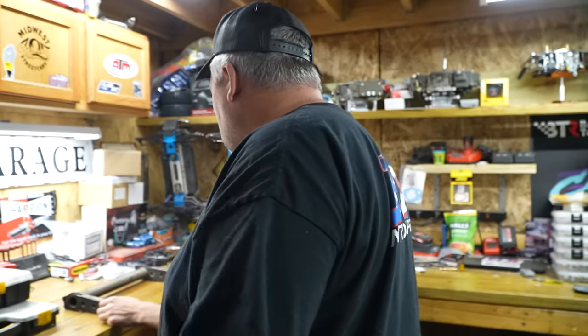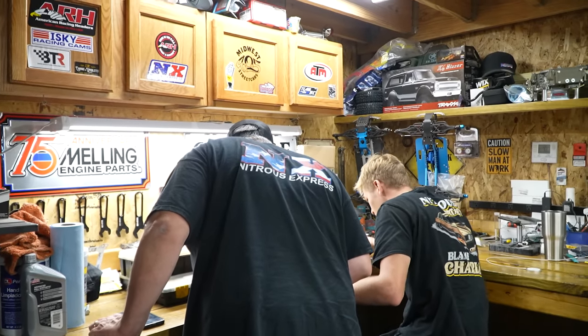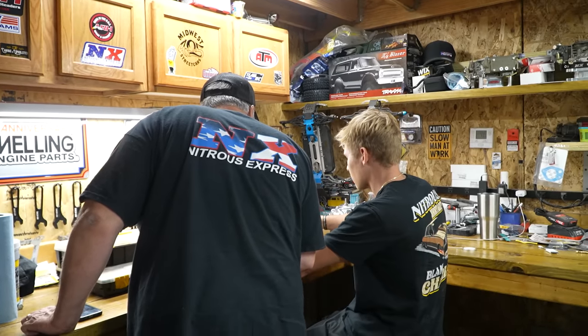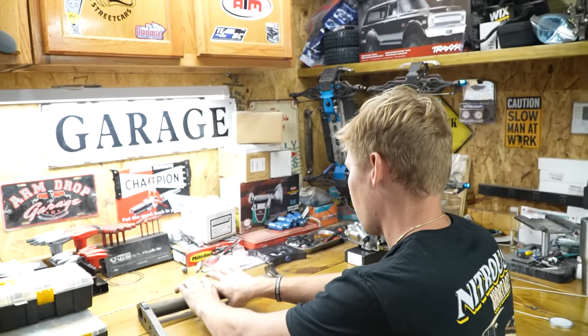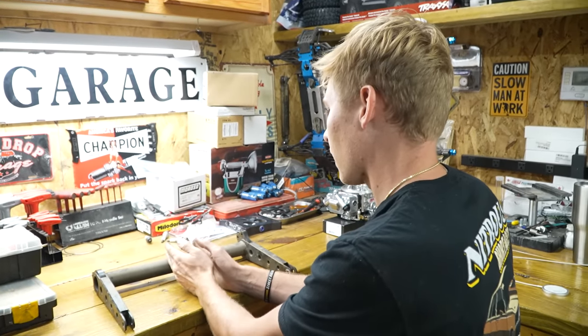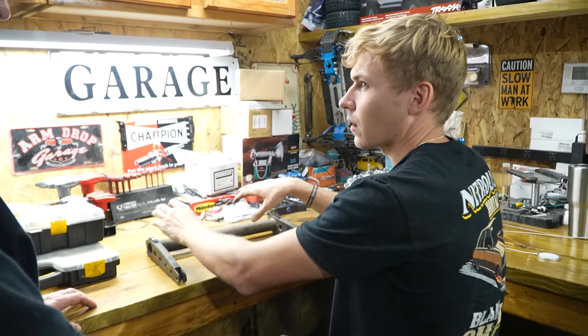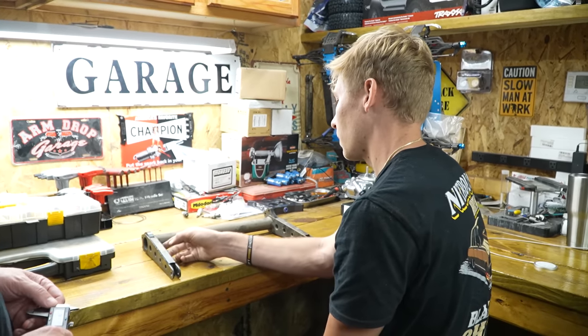We gotta go to the other shop. We should have some inch and 5/8. Cut them all the way over there. It's the only spot that's welded to these arms on this side. So you can just cut that off and put a new one in it? Put a bigger one. I can cut it in half, cut a little bit out of it, put it back together, but with a bigger piece on the outside. Yeah. Slide it over it and weld it back to these arms.